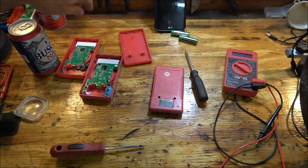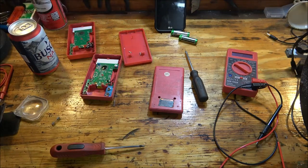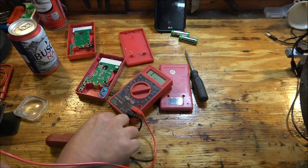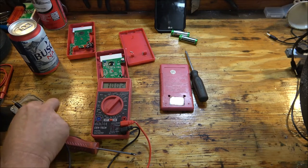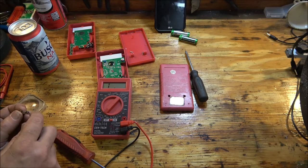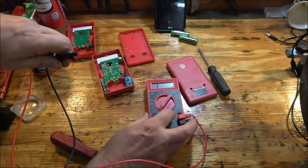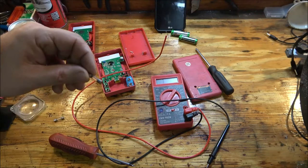I like that they made them removable back in the day. This one you can't just pull it out — you got to unsolder it. So let's use this one. Let's check the continuity. I'm guessing this fuse is blown. I may have one like this — I got some glass fuses over there. It should be doing that, but it's not. So first thing I better do before I get too far is go see if I can find one of these fuses. I'll have to see what size it is — hang on, let me go get a fuse. I'll be damned, I found one.